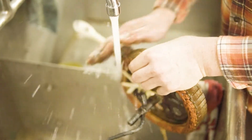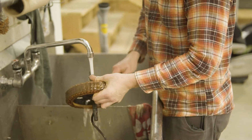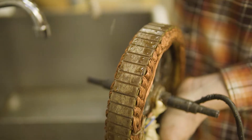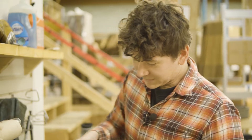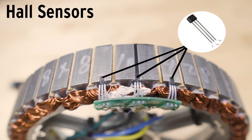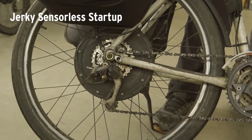I'm just using a nylon bristle brush. You could go at it with a wire brush, which is normally what you use for cleaning rust off steel parts, but just be careful not to scratch and nick your wiring. It doesn't matter if it becomes perfectly clean — we're just trying to get off the loose surface rust. I'm going to more delicately clean up around the hall circuit board. Once this is all dried out, we'll see if all three halls are properly toggling. I was wrong earlier — one of the three hall sensors was not working, so the controller was running in sensorless mode, which is also why you saw a slower ramp up when first hitting the throttle.